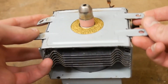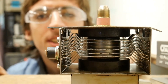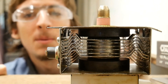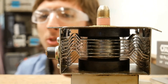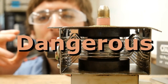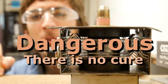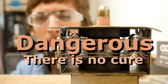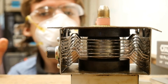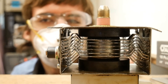I think now we're ready to cut this thing up like a Christmas ham and see what it's really made of. This is very important — you see this pink band here? This is a ceramic insulator that is oftentimes made out of beryllium oxide, which is extremely dangerous. If it's broken and you get particulates either in your mouth or in your lungs, you could potentially develop a condition called berylliosis, which will have both acute and chronic side effects that'll probably end up killing you. And it's also carcinogenic. In fact, magnetrons are full of bad news, so I can't stress enough to wear some proper protection while you work.